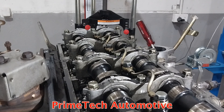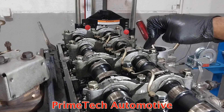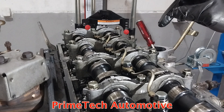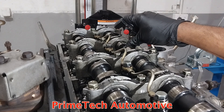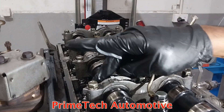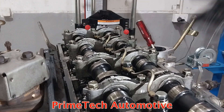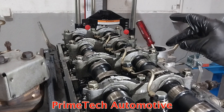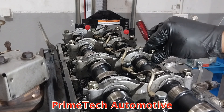I've turned the crankshaft another round and lined up the exhaust and intake cams to the second cycle adjustment position. Now you can do cylinders three and four on the intake side and cylinders two and four on the exhaust side. It's the same procedure as before, so I'm not going to show that part on this video.